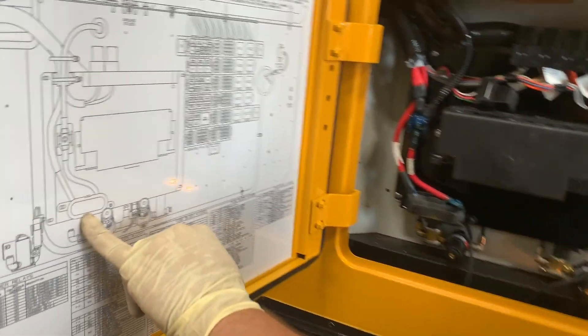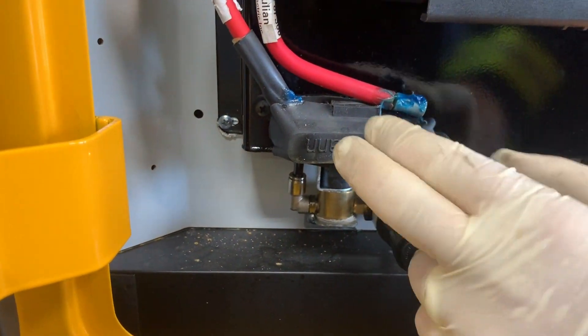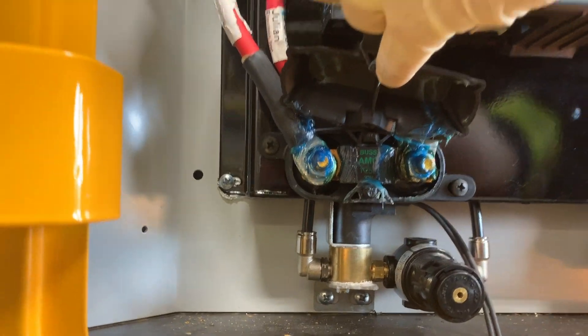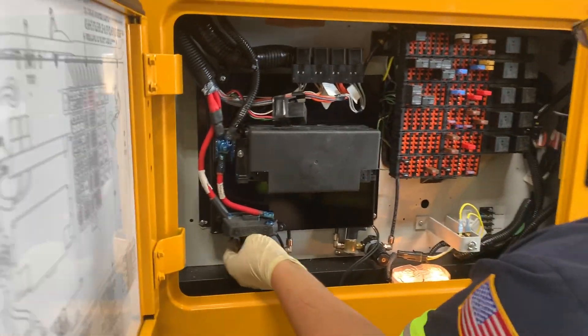What's really cool about this is this fuse panel actually gives you a blank circuit here. Right here is a 125 amp fuse — that is your main power for your body controller, which is located behind the dash. So you just flip this up and there's your fuse right there. That's always a good one to check if you're starting to have a bunch of body issues going on.